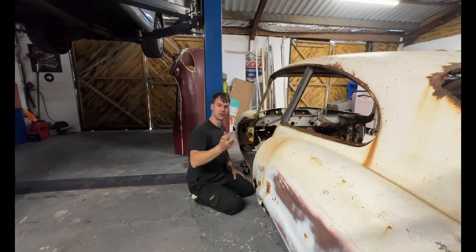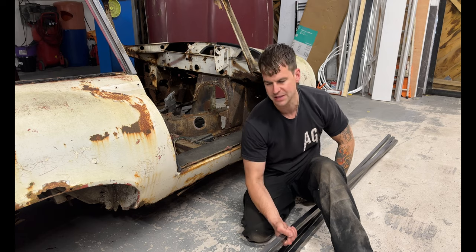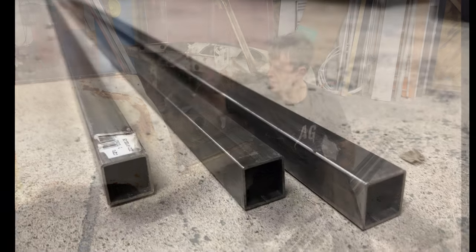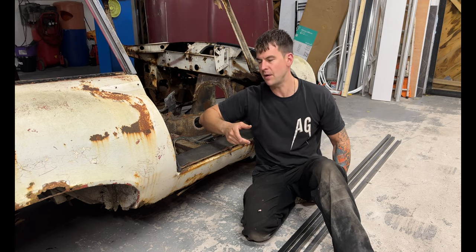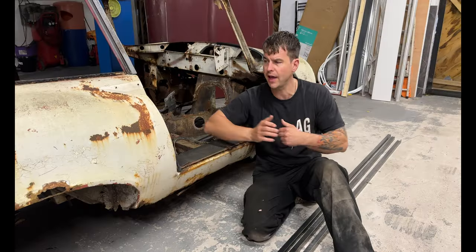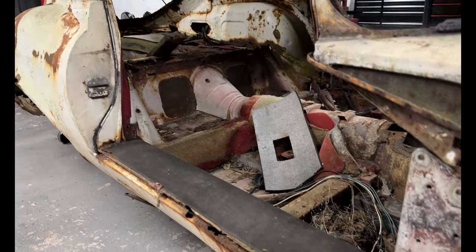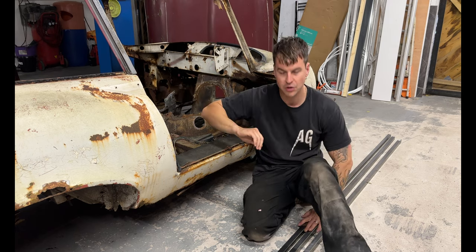What I've got here is one-inch box section steel. I tend to use this because it's very hard to twist, not easy to bend, I always try to get a thick wall, and it's quite lightweight and cheap. I'll weld here to the base of the sill and find a couple of points to go across on here as well. The tricky part is I don't know exactly where the F-Type floor pan is going to end up, since there's a lot of structure behind the seat. I might end up going diagonally again from here across to the front. This front windscreen versus rear quarter area is the part that's going to want to fold in and twist - so locks and box, and let's get welding.